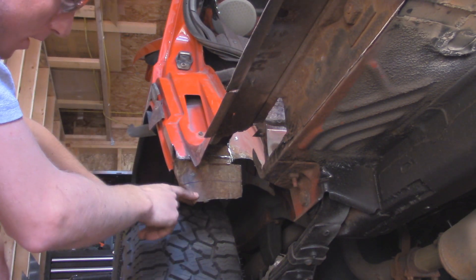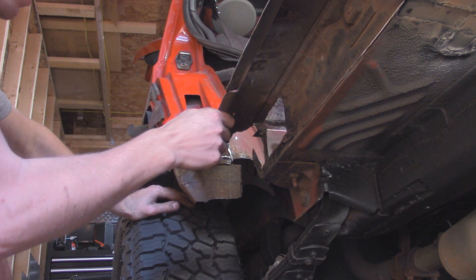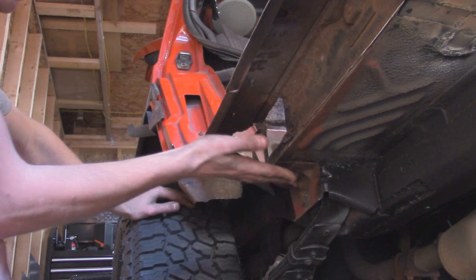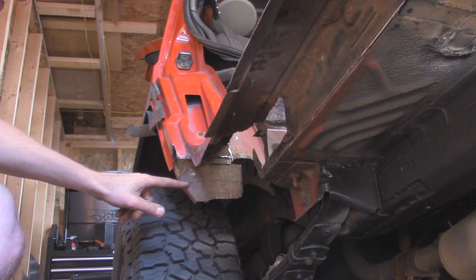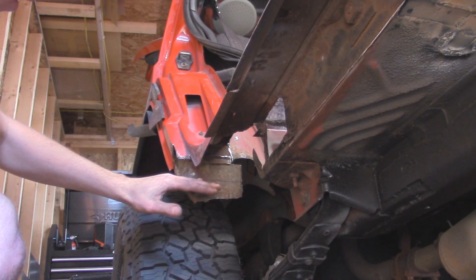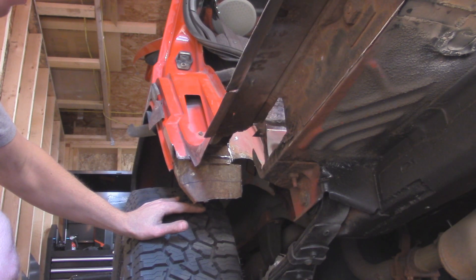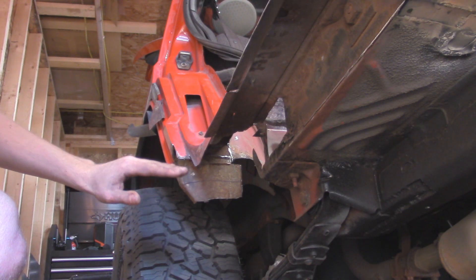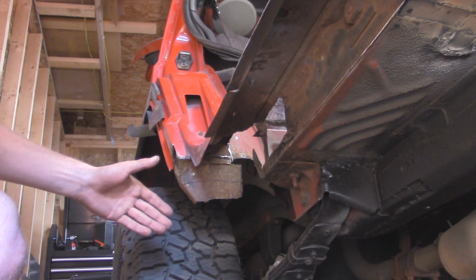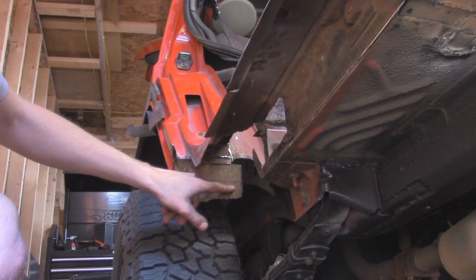I just wanted to show you the piece of plate that's on the back here. Since I did cut off this flange and didn't put a new one on yet, I basically went off the measurement over here where I cut it where the existing rocker was — and that's where basically the top of the 2x6 is going to lay. Then I took a level, just kind of measured it over here and made a rough sketch of where I'm going to have to cut. I did leave it a little bit long, probably an eighth of an inch, so that way we can use a flap disc if we have to grind it down — that way we don't cut too much and still have a good surface to weld on. I'm going to do the same thing for the front side. It's going to be a little bit difficult because I'm leaving the front fender on, but I do have it unbolted a little bit to be able to get an angle grinder in there.